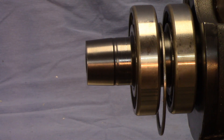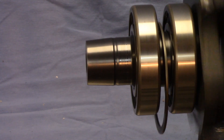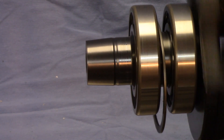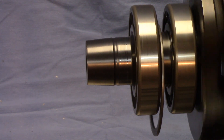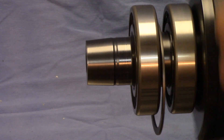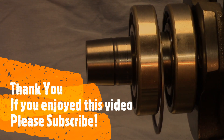Just to give you an idea of what that really looks like in motion, a couple thousandths is really not visible to the naked eye, so I'm going to spin this and you can see for yourself. I would say that's really within the clearance of the bearings themselves, because these are a C3 bearing and C3 bearings actually have additional clearance that's really necessary to allow all these different joints to go together for this crankshaft. That is going to be balanced and it's going to seal good — and that's always what we're going for here.